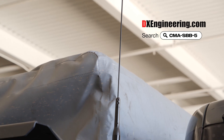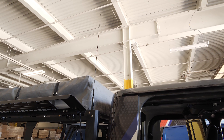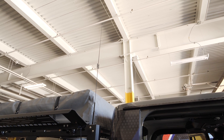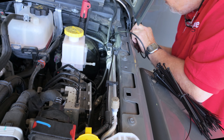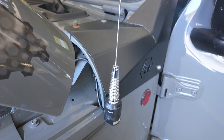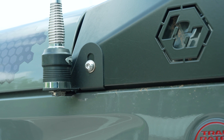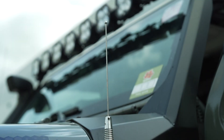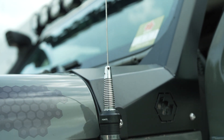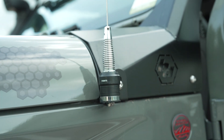Simple and compact, this Comet antenna is plenty durable for off-roading and has a clever folding base that allows us to easily lower the antenna when traversing a narrow trail with a thick canopy overhead, or pulling into a car wash or a low-entry garage. We're also installing a GMRS antenna for a third rugged radio that'll be mounted up front by the driver. This antenna is part of the kit Rugged Radio sells for this Jeep model and comes with an angle bracket tailor-made for underhood mounting. Many off-road parks and expeditions require GMRS radios now, so adding GMRS capability is a smart forward-thinking move, and even with the additional trail armor on the cowl and A-pillar, installing this compact antenna mount was still a very easy job.